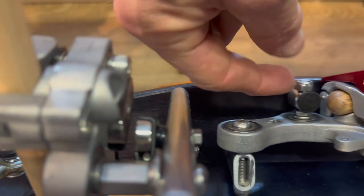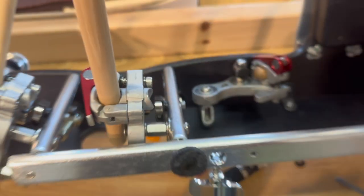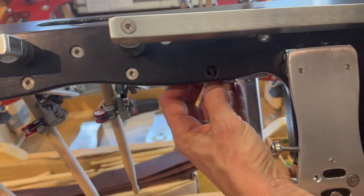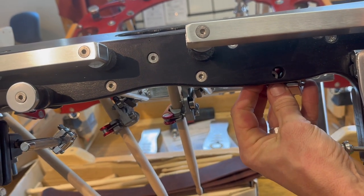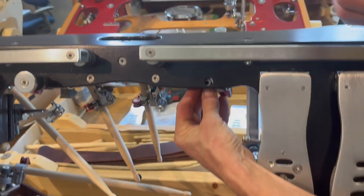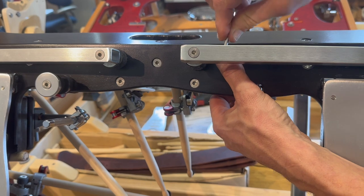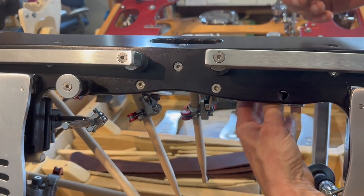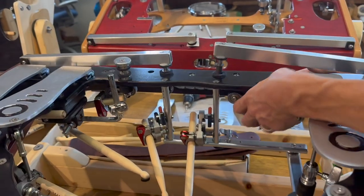It's up against the back. And what I'm going to do now is kind of line it up a little bit. My toe post is right here, and I want to line it up with that hole that's underneath. So let's flip it across and now I get a clear shot. I might want to come down just a little bit, so I'm going to pull that down, just so that I see that it's nice and lined up. I'm going to do my final turns. You can really lean into that - it's okay, it's going to lock into the wood. That's recessed enough where it's not going to be in your way.